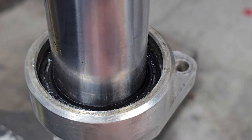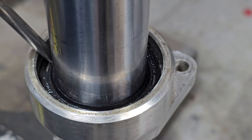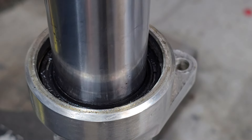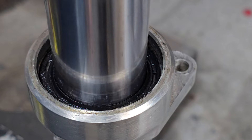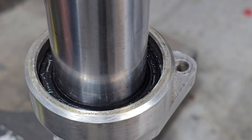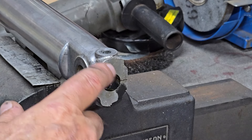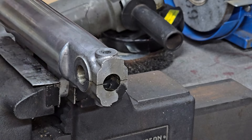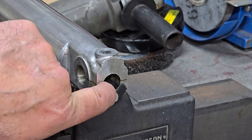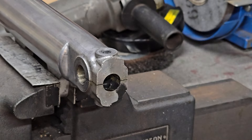All these parts are generally replaceable, and in there you can just see the edge of the seal. We've got the oil out now, and it doesn't matter whether it was this one that was leaking - we've got to replace both anyway. The inner and outer part of this fork is now held together by that allen bolt we loosened earlier, so that now needs to come out.